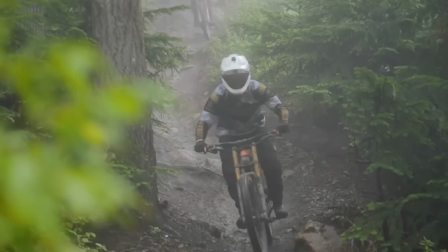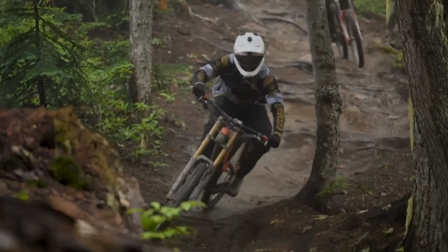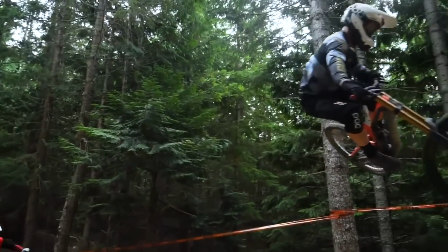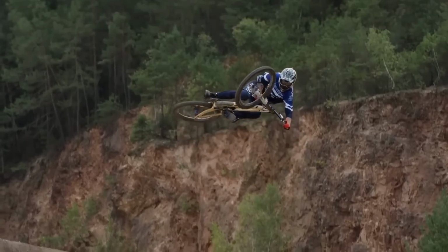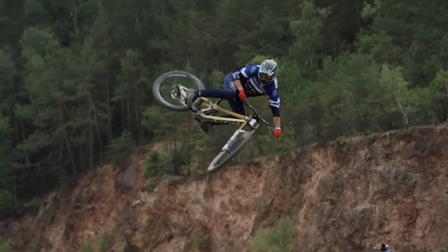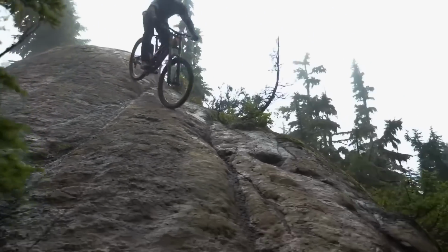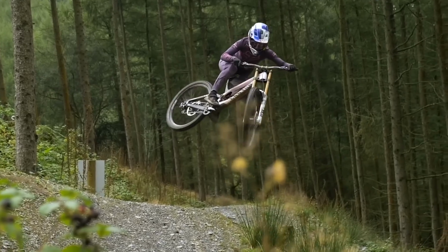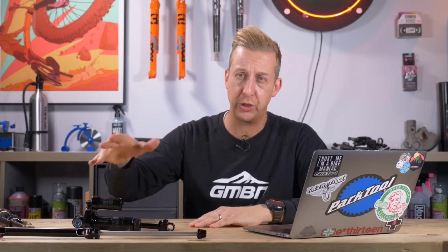But in terms of actual riding, let's just split this in half completely. We'll talk about cross-country bikes and downhill bikes. On a downhill bike, you almost certainly would prefer to have a progressive feeling back end because of the way that you load the bike into such abusive trail sections. You want the bike to retain its composure. If it's clapping through that travel all the time, that's really hard for the shock to control accordingly. So a more progressive feeling back end is going to be better when you're really pushing into stuff hard.